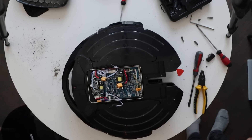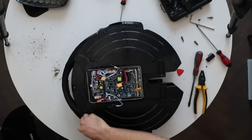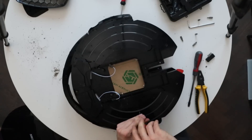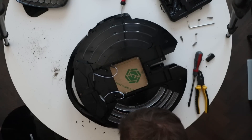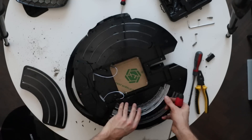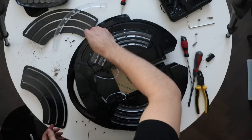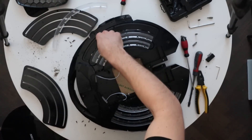To take the wheel apart further, remove another set of hex screws — very small ones this time. To access the screws holding the two shells together, you also need to remove the LED covers, which are held in by another seven Phillips head screws each. Once removed, you can access the LED RGB panels — and as it turns out, these aren't true RGB panels but LED strips with a plexi element in front to diffuse the light. This is the same approach used on the V11's rear tail light, and it looks really good on the V10F — a very clever design.